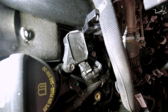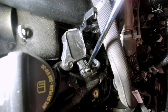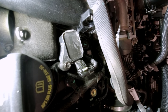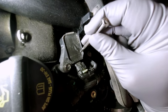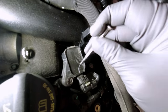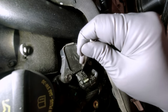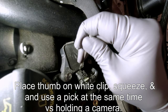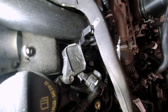Here's a quick close-up of what I did to get the connectors released. Put the screwdriver here and popped it up. You can go to an auto parts store and find a pick set. I improvised and sacrificed a flathead screwdriver, bending it with a curve and a nice sharp edge, to get up under there, lift the clip — there's a little plastic tab — getting under it very gently, lift up and pull back. You'll do that on the rest of them.